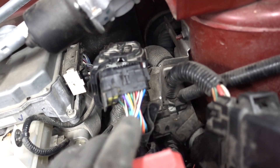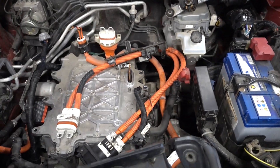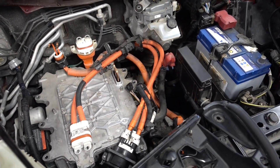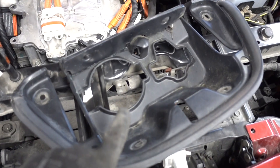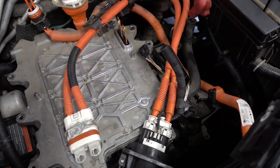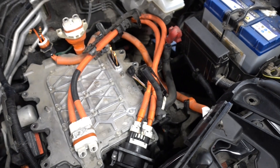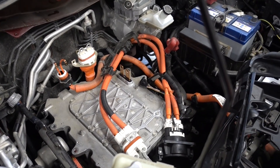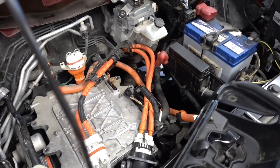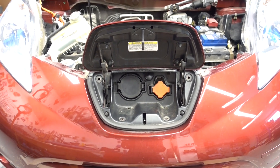After some struggling, the new wiring loom is in, and you can see there is now an extra set of wires. Now it's time to mount the new CHAdeMO cable while the PDM is still off. I've taken this plastic bit and dremeled out where the CHAdeMO should come in, and now it's time to mount this cable. I'll attach it here on the side of the inverter — and I ran over to look at my personal vehicle for reference. Wow, it looks like a factory install!